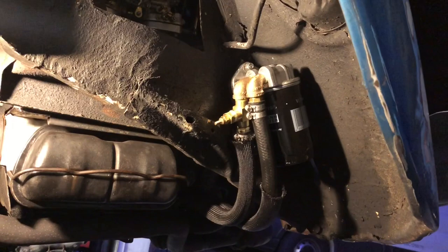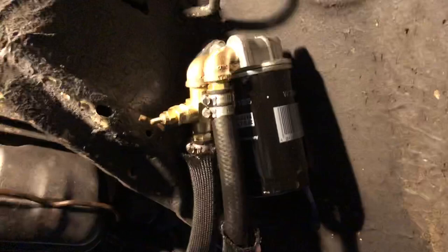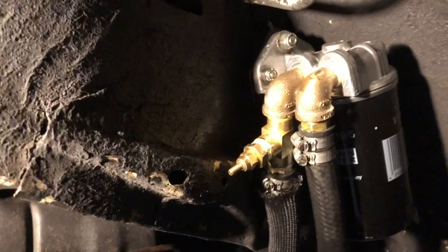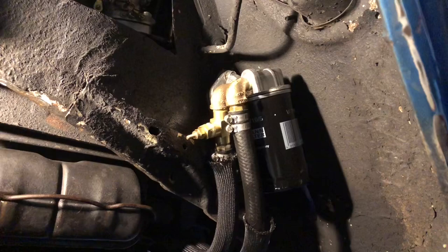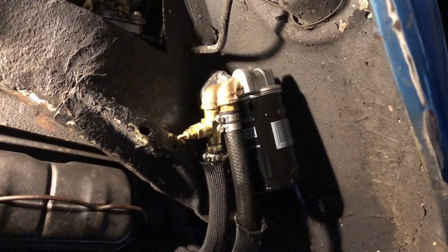The time-lapse definitely makes quick work of things, but that's how we're plumbed. As you saw, we went ahead and cleaned everything down with brake clean just to make sure everything's nice and clean, so if we have a leak we can see where. You also noticed I was using Teflon tape. That Teflon tape is yellow and not white. White is regular plumbing; yellow is rated for gas and oil. Moving on, we need to go ahead and run the wire for the sensor into the car.